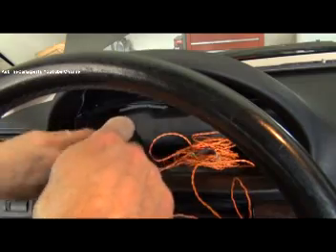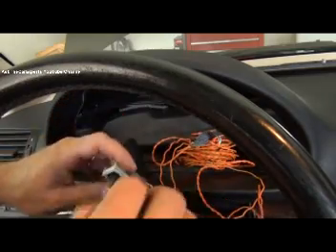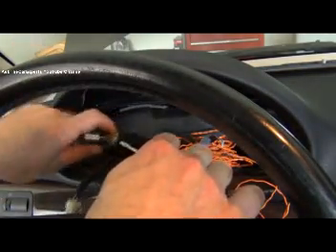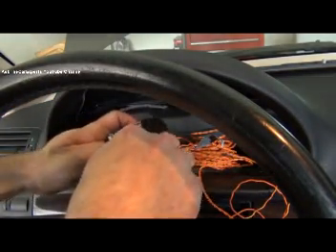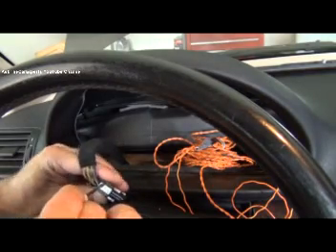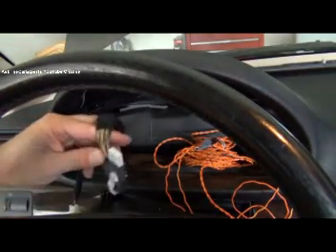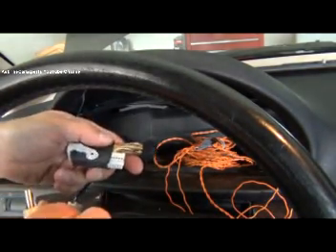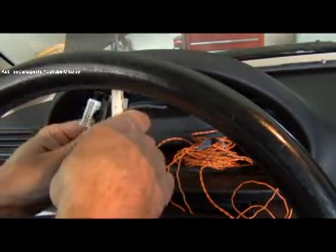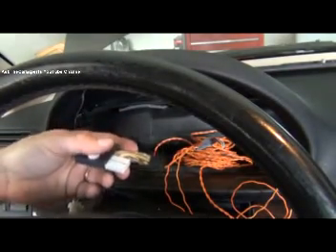First thing I want to do is check my power supply. If my instrument cluster isn't working I'm going to check the power supply and ground. I'm going to disassemble this connector to show you what you're looking at. On the back side of the connectors there's a little tab — you only have to pry that tab over to the side with a small screwdriver, apply some back pressure, and slide the housing right off. Keep track of which housing is which.